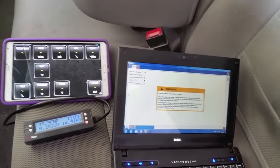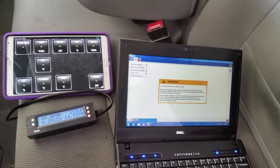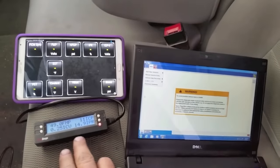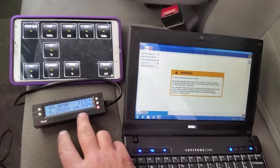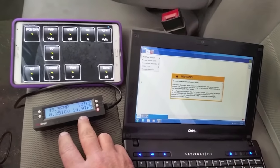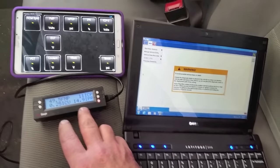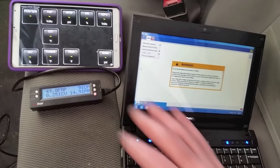If you have the sync issue and you have RPM, most likely it's not the crank sensor or the wiring to it. Most of the time the issue is wiring, or a problem with the batteries. Also, I see a lot of people with a scan gauge who have their input wrong — so before you cut up your wire loom, I strongly suggest re-entering your scan gauge settings or trying it on another truck.